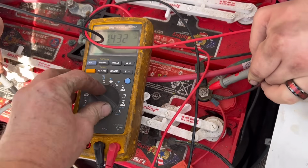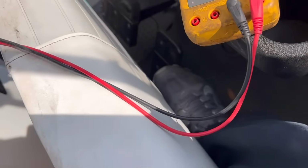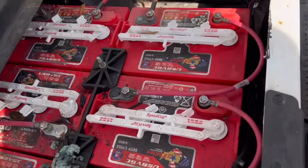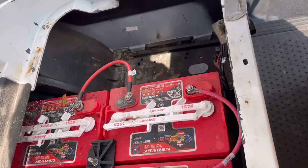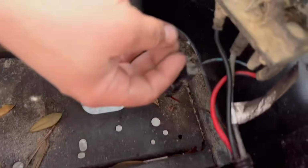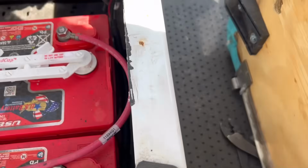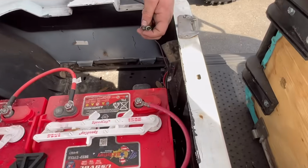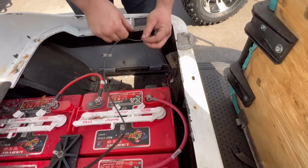All right. Now, the first thing you do when you go to a 48 volt cart is turn it, put it in reverse. Reverse buzzer don't work. You check one thing only: the reed switch or the charging port. Well, you bypass the charging port. So unplug the charging port there. On the back of your charging port, you have the anti-lockout switch. If the customer does not have the charging port unplugged, or the reverse buzzer done away with, it should come on in reverse, and it don't.